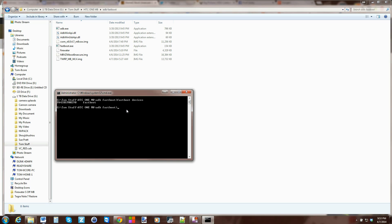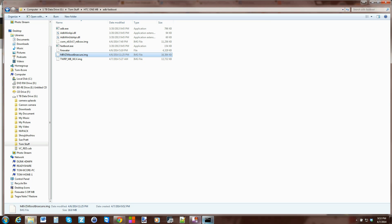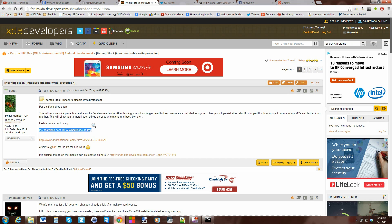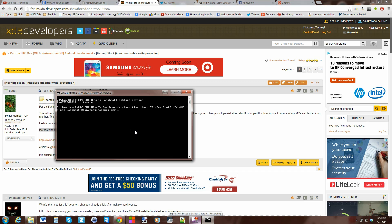It comes back with a number and says fastboot, so we can then flash this over with the command `fastboot flash boot`. Then take your file, click on it, and drag it into the command window — so you should have `fastboot flash boot` space and then the filename. Or you can type the full filename; either way works the same. It's just easier to drag it in. You can also copy the command directly from the instructions once you have the file in your folder.